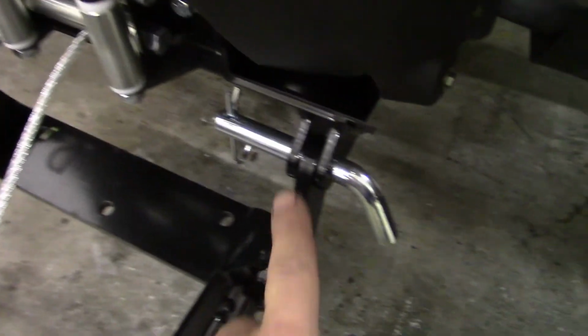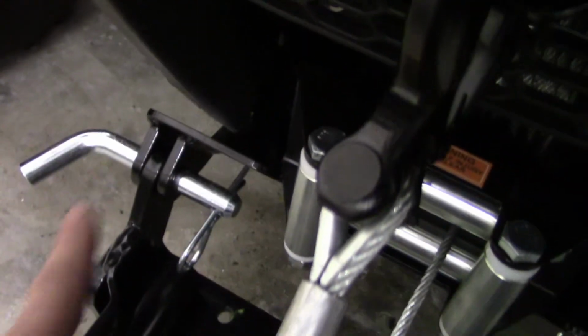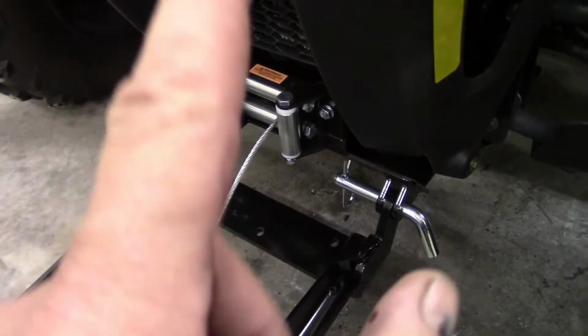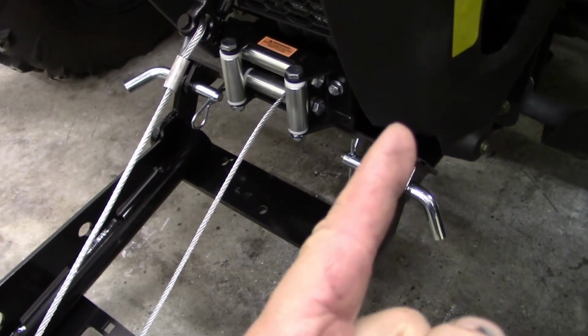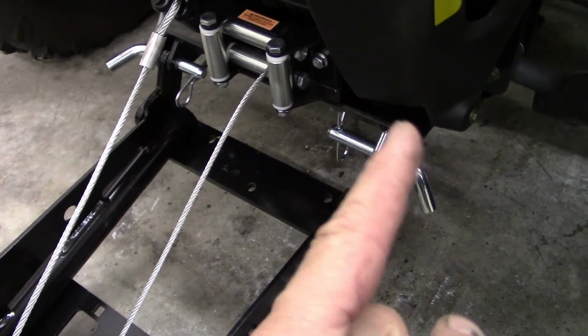It's the KFI winch. And here's the mounting plate. This is on the machine with the little ears on it on both sides where your plow attaches. So when you put this on, of course, you start with the winch, get the winch on, then this plow mount bracket has to go. You have to pull your fairlead off. It's got to go between the fairlead and the winch mount bracket. Then you're ready to go.